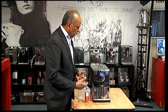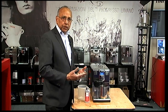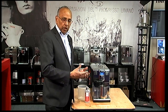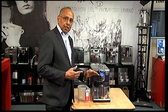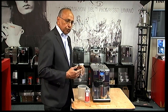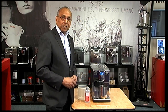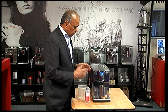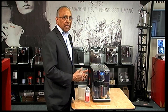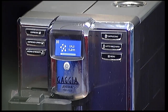You really follow through whatever it asks you to do. If the water level goes down, you need to fill the water tank to refresh water. It's going to pause for a little while as the descaling solution and the water you've put in is being drawn in and left there. It keeps pumping water from time to time, so just leave it — go have a cup of tea because you haven't got your coffee machine. We'll come back and go on to the next stage.